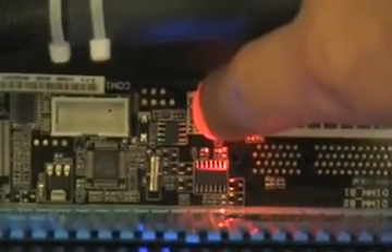Can't see the screen, so there's no post. We have no post right now. What I'm going to do is hold the MemOK button for three seconds and release it once it's flashing again.